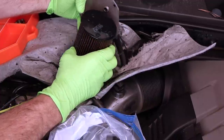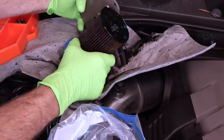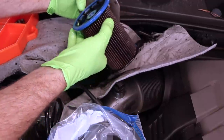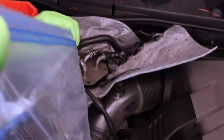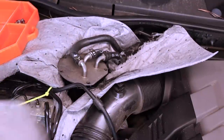What I like to do is back it over where our absorbent mat is and just dump the contents of the filter out, set it upside down, let it drain. This filter wasn't actually super dirty — not the worst I've seen anyway. But since we're right at that 80k, it's a good opportunity to do it. Let that drip out as much as you really feel like waiting, then swoop it right into your bag, zip it up, and set it to the side. Now I spilled a little fuel here, so let's clean that up.